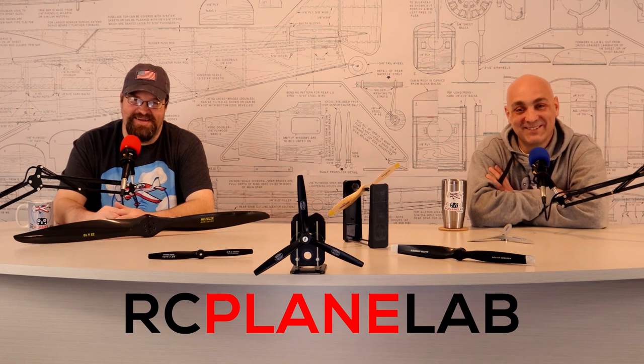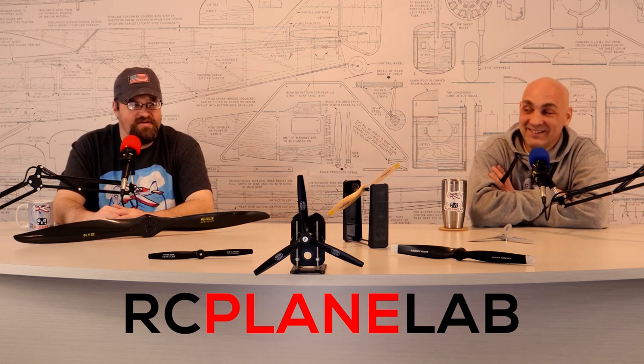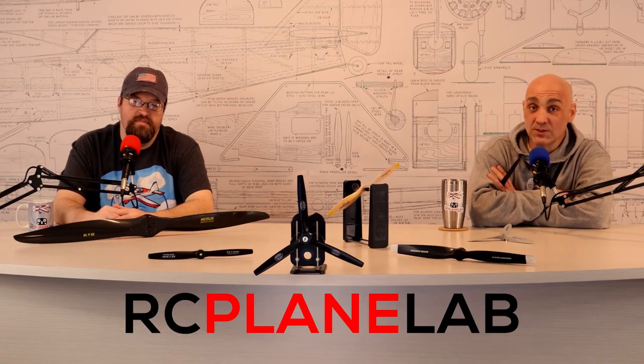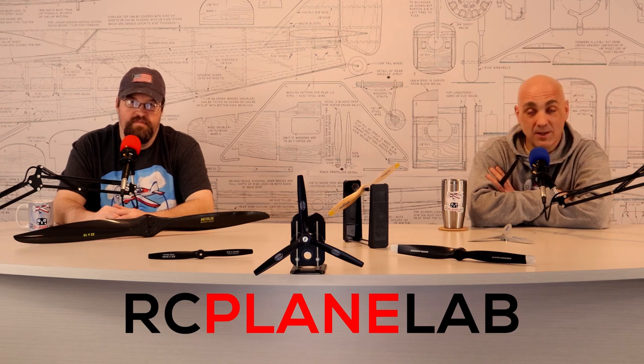That makes sense because that's the biggest thing that's spinning. Exactly. Well, I mean, it should be the only thing that's spinning, hopefully. Well, okay, I guess you've got a point. Maybe a wheel can spin when you're taking off. Yeah. It can cause excess fuel consumption too. It takes more energy to spin that propeller at the same RPM than it does a balanced propeller. So if fuel consumption is an issue, an imbalanced propeller will cause more fuel consumption.